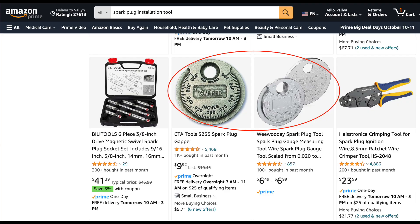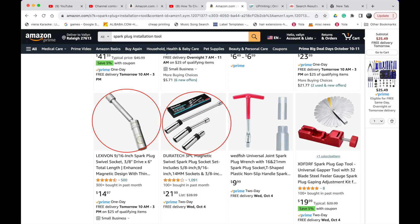This is a spark plug gapper. You can buy this at the local store — it's probably around $3 to $5, not expensive at all. Grab it while you're asking about spark plugs and ignition coils. For this job you're also going to need an extension for your spark plug socket, approximately six inches long or a little longer — that will be perfect.